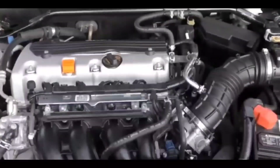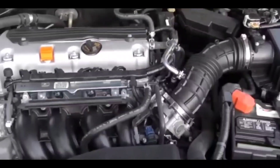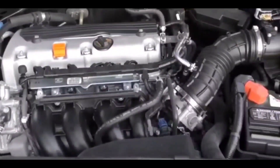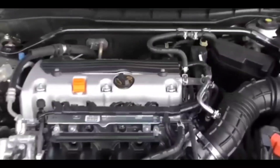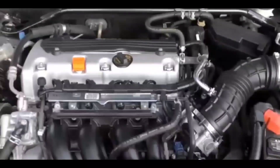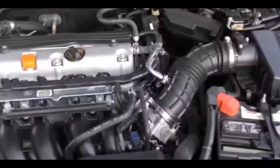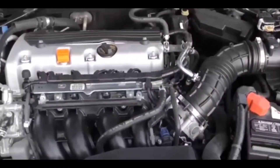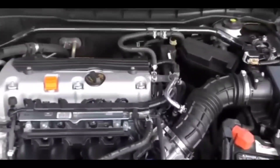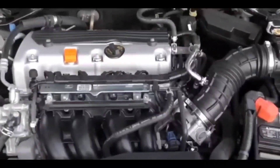And I recalled to myself — there was no check engine light. I remember looking at the dash and I didn't recall a check engine light because I would have noticed it. If any of those components — the mass airflow sensor, the crankshaft sensor, the camshaft sensor, the throttle position sensor — if any of those sensors had any issues whatsoever, 99% of the time the check engine light will illuminate or at least blink.